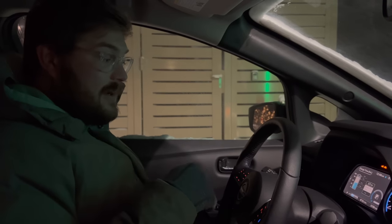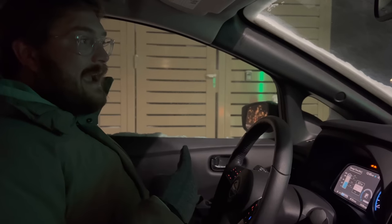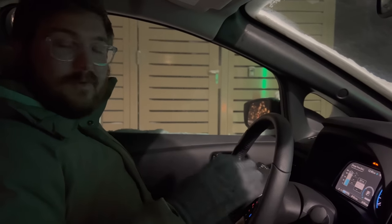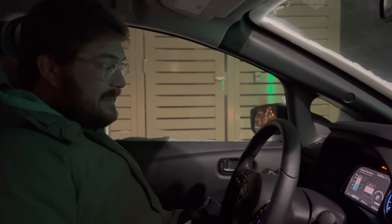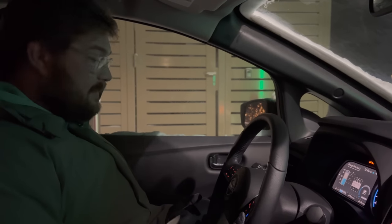That's a surprise. In full comparison, we took our Tesla Model 3 Performance just earlier this evening. It was minus 12 when we did that test. We dropped all the cars off at roughly the same time, for 2 days, and that car turned into an ice brick. It took 45 minutes before it accepted any power into the battery pack. It ran a 7 kilowatt heater for 45 minutes before it was like, yes, give me even the slightest drop of juice. And this thing is just like, yeah, 3 kilowatts into the battery. Crazy. Wow. Heated steering wheel, heated seats.